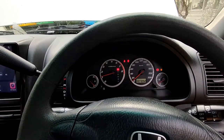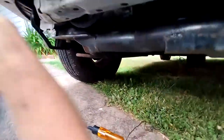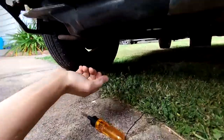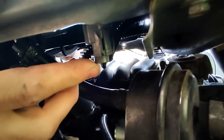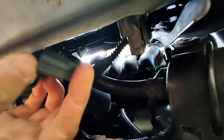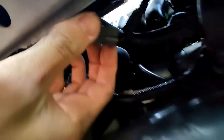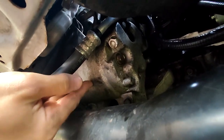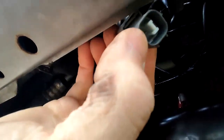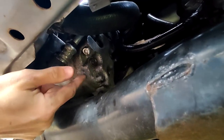I've removed the plastic trim that's normally living down here, and I've got my 12 volt tester. I've connected this up to the sump for earthing. There's a single wire - I've got the radiator switch here and next to it is a single wire that runs off to the top of the AC compressor. What I'm going to do now is turn the car back on and enable the AC. The clutch won't engage on here, but I just want to test that there is 12 volts going to it, which would tell me that when the AC is turned on it's telling the compressor to start.